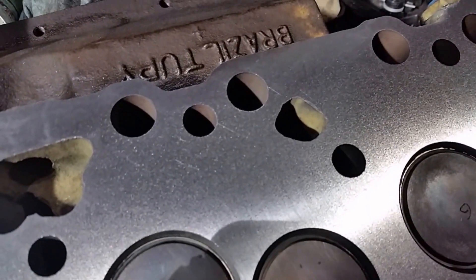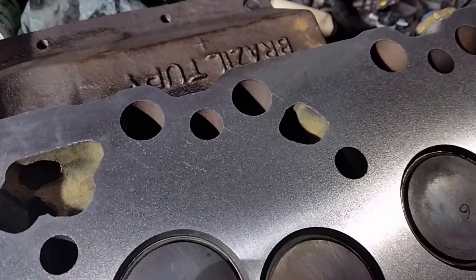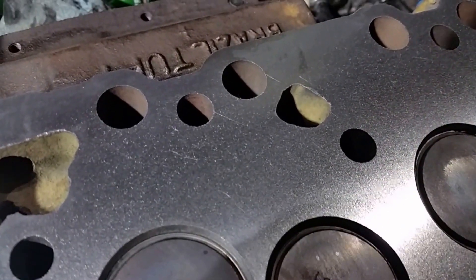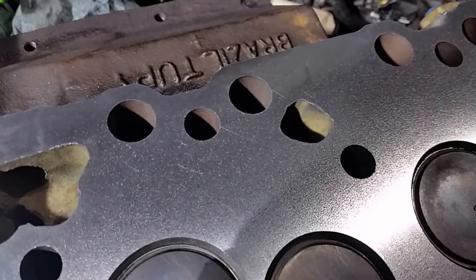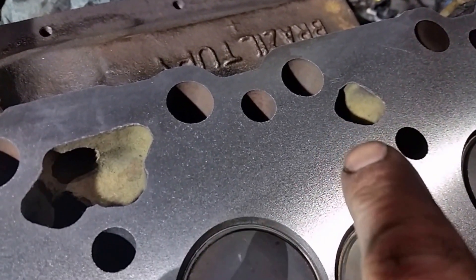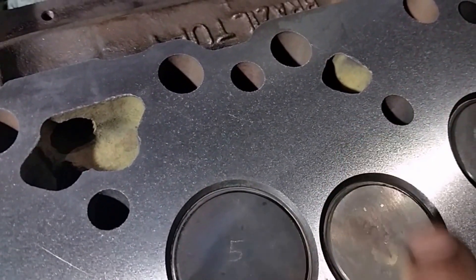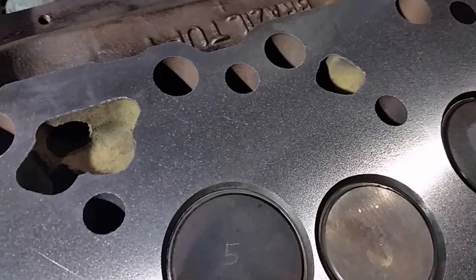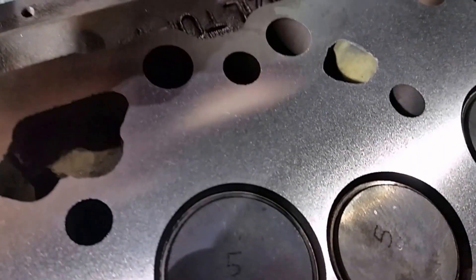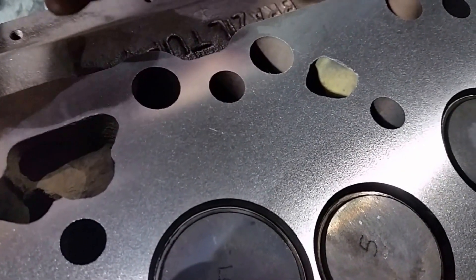So this is the black hole saga with the leaking head gasket continued. In the first part of the video you saw it streaming down the side of the block. This obviously looks fantastic because it just came out of the machine shop - it's been decked and it's ready to go back on. What we found when we pulled this part was a little leak between - this is the number five cylinder here. We found just a little bit of pitting in between the water jackets on number five and the block. It was right across here, and what was happening is it would go through the water jacket and it was escaping out around the head gasket and then trickling down the side of the block.